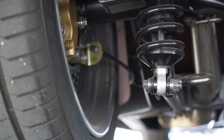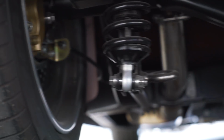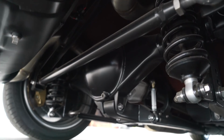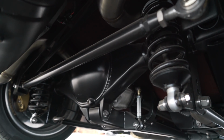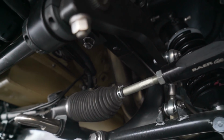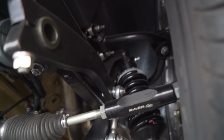What's the suspension? Well, it started life as an Art Morrison frame made for the car, but it had to get altered more. So we got together with Mike Meyer, and we've got one of his torque arms, kind of the stuff you would have in your IROC-Z or in a Grand National. Long torque arm, 2 lower links at the rear axle housing, and then a Panhard bar, and then coilovers. It saved us room, and it made the car very stable. That long torque arm is great for stability, which works great on this long wheelbase wagon. Beautiful. It's a cool car for a super nice guy.